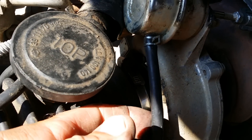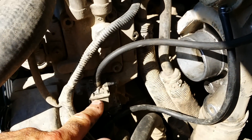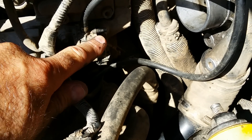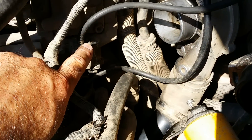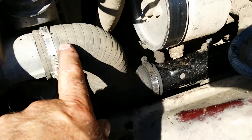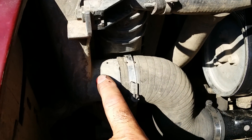This is not a vacuum hose — it's actually a pressure hose. You've got one little pipe here that goes down to a modulator control valve; it's that little component that plays up. There's a plug there and you've got three hoses: one there, one I've taken off, and one underneath. This main one goes to your air trunking, the second one would go up to the turbocharger, and the third one — if you follow this main outlet — goes underneath, under the power steering pump, up to the turbo intercooler.